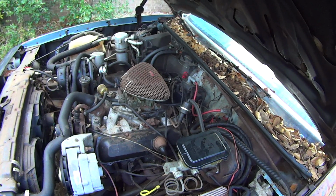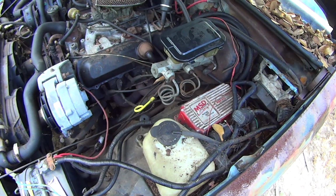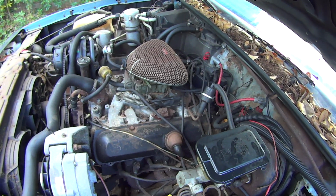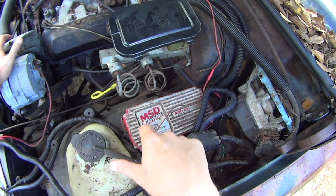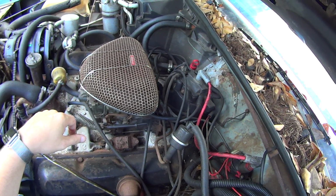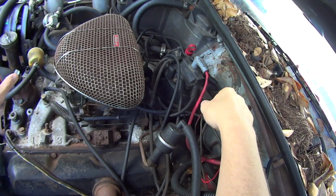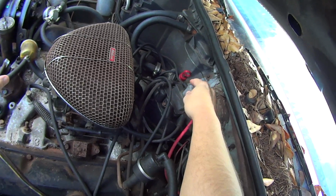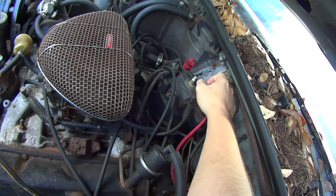Now, being as young, dumb, and broke as I was when I built this engine, it is a marvel in broke-ass engineering. That is to say, it's a marvel that any of it actually worked. For example, I got the MSD6AL ignition box. I received this box in lieu of payment for some automotive work. I did not have the actual MSD distributor, so what I did was I took an ordinary GM HEI distributor, hollowed out the coil area, and I took a spark tower from another distributor cap and just epoxied it onto the top,